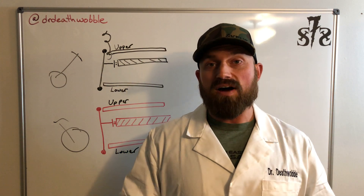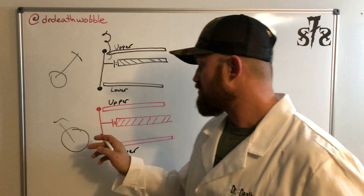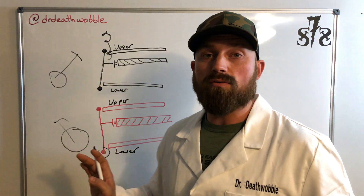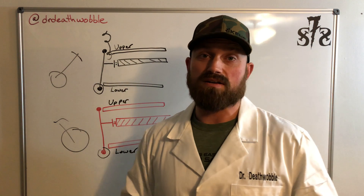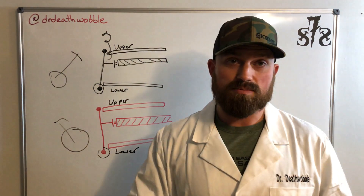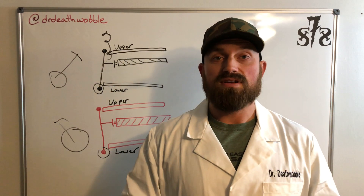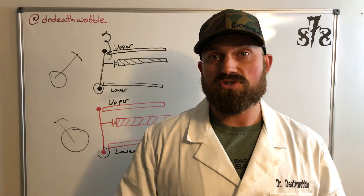So one way or another, we have to push that lower control arm longer and push that lower ball joint out further forward to get our caster angle back to spec, or even better than spec. Because the further forward I push that, the more resistance I'm going to feel — just like a chopper motorcycle. The further you put that rake on there, the more fight you're going to have. In the shop all the time, we see JKs with a three-inch lift where manufacturers aren't including lower control arms or caster shims. The reasoning behind that is it's made to be with a full kit.